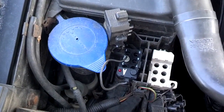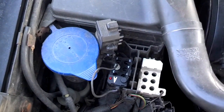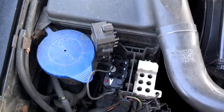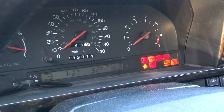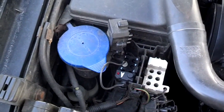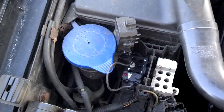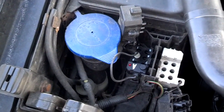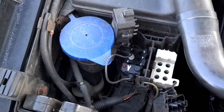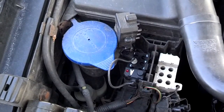Now that I have the jump wire plugged into the A2 port, I'm going to go inside and turn the ignition switch to the on position — not to start the car, but just to make sure all the warning lights are lit. The car is in the on position to run the test. Now I'm going to press the button and release it, holding it down for about a second. When I release it, if there's an error code in that fuel system port, the error code will flash on that little light in three series of flashes. You have to count and record each series.